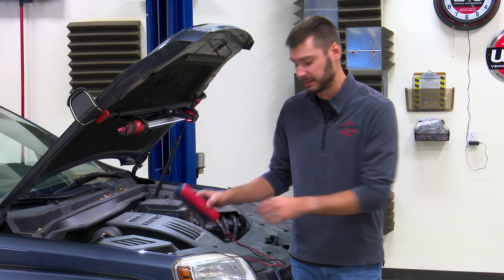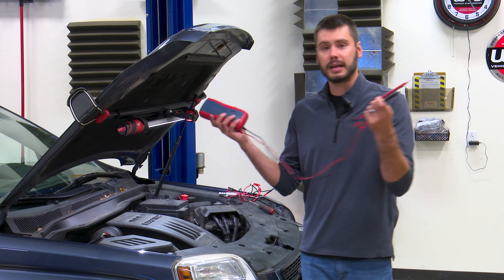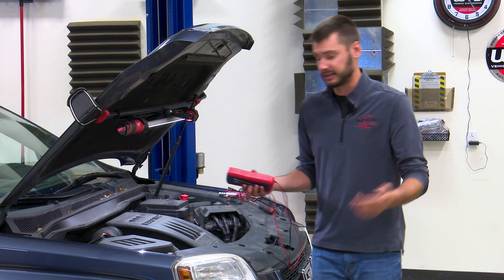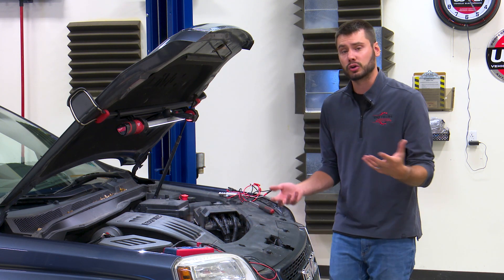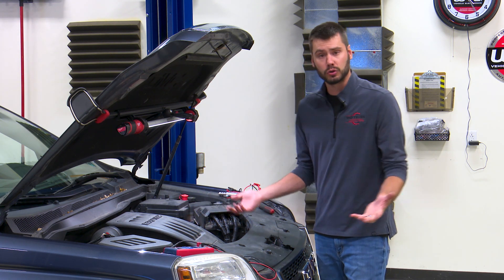Because of that, we're just going to do a simple test today using a multimeter to check the spec on the solenoids and see what the resistance value is on them. These solenoids are incredibly common on this engine, so let's get right into it.